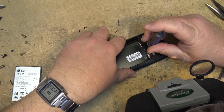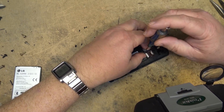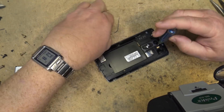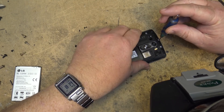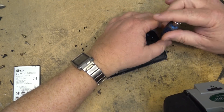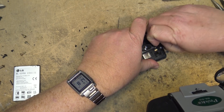What I'm going to do when I get this thing apart is put my heat gun on and heat the chip up to try to reflow the solder. I'm then going to put some heat sink compound on the chip, and we're going to do the little mod where you fold up a piece of paper on one of the connectors, which puts more tension on the connector.